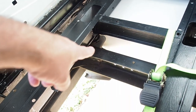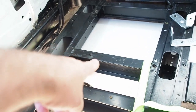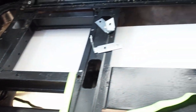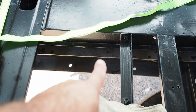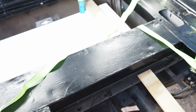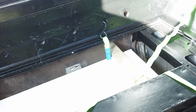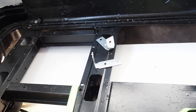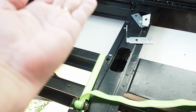I'm going to bolt it down here and bolt it to the edge over there, and also on these two lips just here. I'm going to put three lots of support — one here which will squeeze in between here, same over here bolted to that, and then same down the end, squeezing the 40mm tubing in there bolted over there, which should secure it. Then I'm going to run threaded rod down either side and underneath use the metal tube again, drilled through the threaded rod to come up and hold that up.